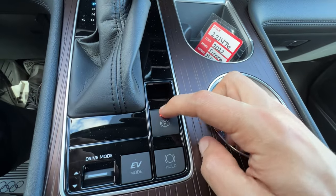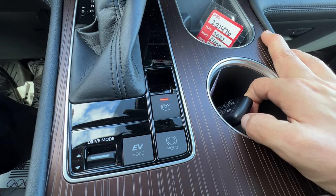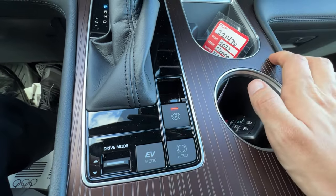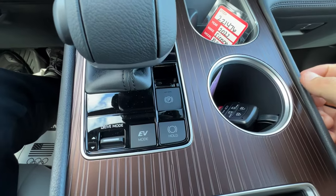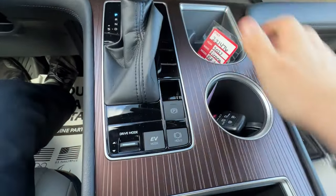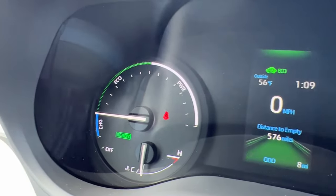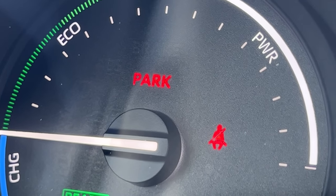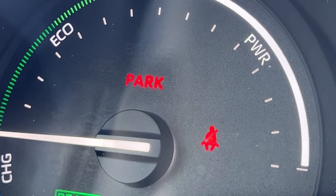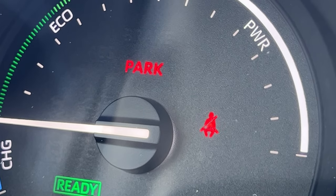Here's the parking brake lever — I don't have to push it manually. They give you the option for when you bring it in for service or if it's super cold and you drove through water and don't want the parking brake to freeze. For most people just leave it as is — when you take it out of park it releases on its own, and when you put it back in park it re-engages within two seconds. A little red 'park' symbol tells you if it's on — you can even hear it and feel a little pressure change on the pedal. Pro tip: keep your foot on the brake until it says park, then take your foot off and it won't roll.